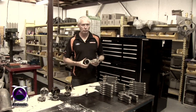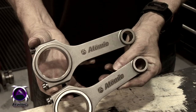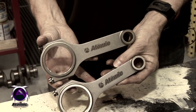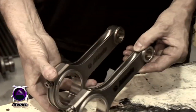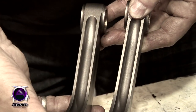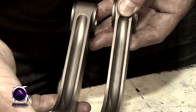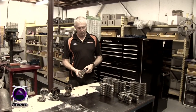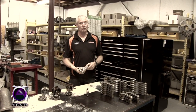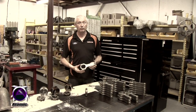For the guys that really want to make a big banger engine, we make another conrod — what we call the fat rod. As you can see, with the fat rod we've trimmed away a lot less material from the 4340 chrome moly blank that we use as a starting point. We still have the pressurized oil feed from the conrod bearing up to the gudgeon pin bush, and we still have the piston crown cooling, but with a much heavier, beefier beam it's able to withstand a lot more load. We've run these over 1,300 horsepower with total reliability.